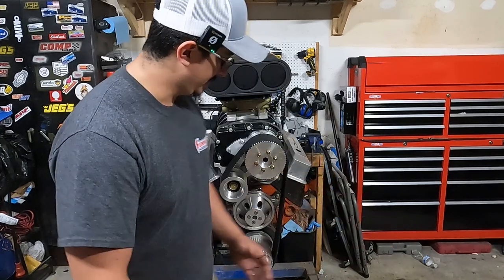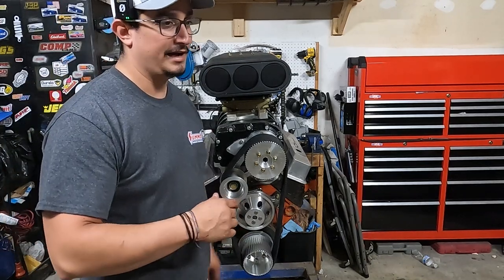There are a bunch of different things — other systems you got to work on just to run this beast. Right now on Hank, he has a stock-style 63 amp alternator. And I think at this point with that new fuel pump, it's about tapped out, because when it's really pumping I start losing pressure and the lights start dimming — not a good show. So I got a new alternator coming, a new setup, and that's all going to be taken care of. That's something you got to consider when you're putting all these electronics on your old truck or old car. You got to make sure your electronics can handle it. So with a 105 amp alternator I should be good — if not, I'll bump it up to 140. I'm going to stick with the V-Belt drive. I think it's a CS-130 I got coming. To run all this, you got to run the computer, the fuel pump, the coil for the HyperSpark — there's a lot of stuff. Hank was a very basic old school truck, and now we're making him into a little bit more moderate, because we're still using a blower. I still got a bunch of stuff left to do, but we're making progress. It's August 21st — I'm thinking maybe in about a month I'll be doing the install. I'm working out a lot of little bugs on Hank right now, making sure it's prepped and a good foundation to throw this thing in. Give me a little bit more time; I know some of you are anxious for that install video.